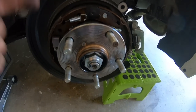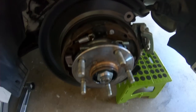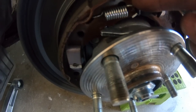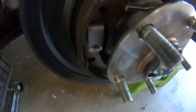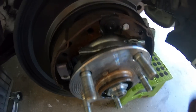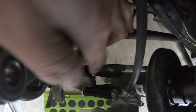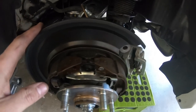Huge shout out to Brian Small - he's a master Subaru technician, buddy of mine, friend of my dad. I've been sending him some pictures and stuff. You do have to remove all these first - these are going to stop you from removing this parking brake assembly. There are 14mm bolts on the back, down in here by the axle - there's four of them. Get those after we get these springs out, and then we should be able to remove this cover.